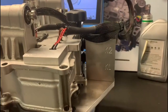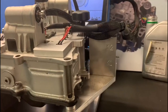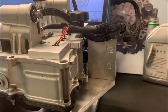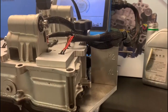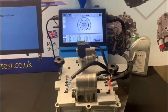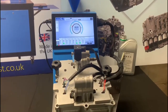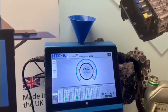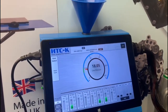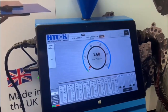You can see the K1 sliding out there and back in once again — monitoring the clutch actuators closely. Now we are completing a drain cycle, so obviously dropping the pressure within the unit. Those are the safety features, and at the end of this test a graph will jump onto your screen and you can make direct comparisons collected from a known good unit compared to this one that we're testing.